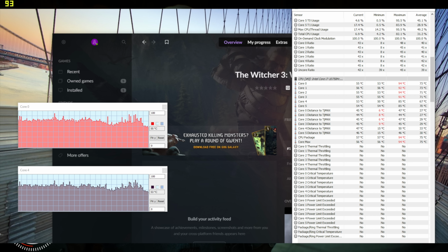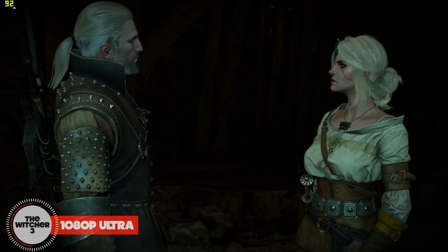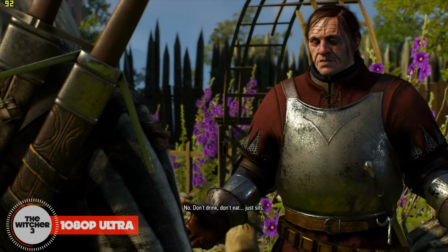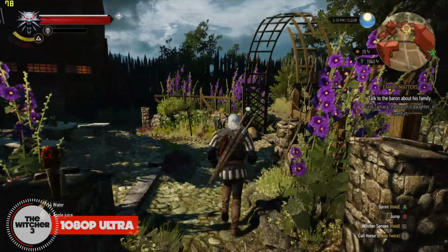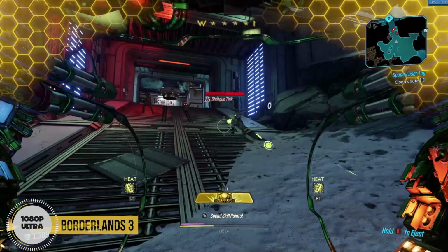Anyway, frame rates in the games were excellent on this. Yes, you're getting performance in spades on this. Temperatures are lower. Yes, you can undervolt this too. I know some people are wondering because there have been some BIOS mitigations in some laptops for the Plundervolt, say that 3 times fast, vulnerability. But anyway, this one lets you undervolt it using Intel XTU. Now, 10th gen CPUs can't take as much undervolting without crashing versus previous gens, but I was running it at negative 90 for the undervolt, and the CPU core cache undervolt at about negative 50, and it dropped temperatures again, depending on the game, like The Witcher 3, about 8 to 9 degrees centigrade. And some other games like Borderlands 3 didn't make as much of a difference, maybe 2 degrees.